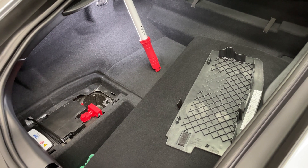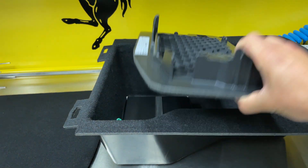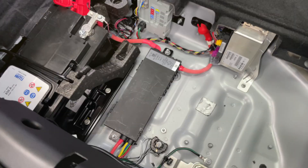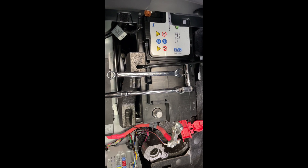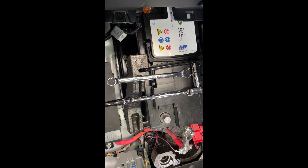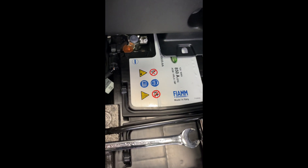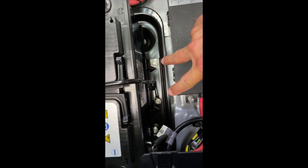Let's get this out — I'll see you guys in a couple minutes. There are three covers here. You first take this cover off in the trunk, then this cover is over the battery, then you take the little cover off there. Removing those covers just kind of slide and clip — you've got to wiggle them out. Just so you know, if you want to remove your battery and do the same thing, you need a 13 millimeter socket for the positive — remove the positive. For the negative, there's that little bolt, and that's 10 mil. It is also a 10 millimeter for these two bolts here.